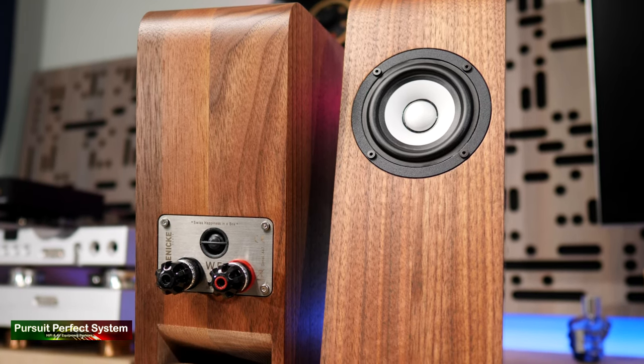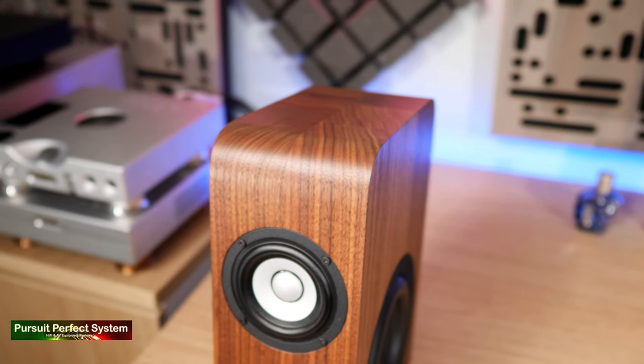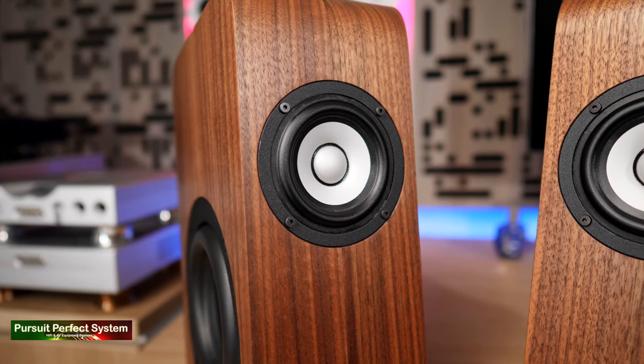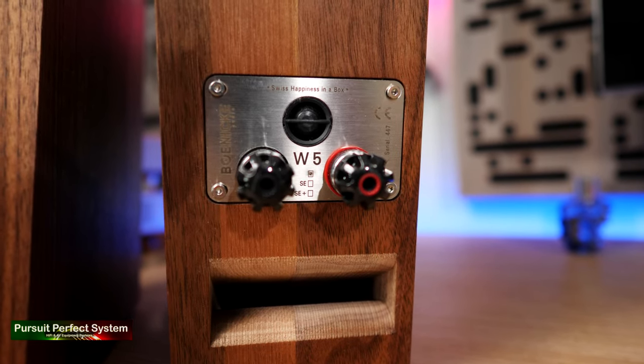One thing you are very aware of is the excellent treble detail retrieval from the forward firing and rear firing driver combination. Now, I was fully expecting the W5s to have quite a rolled off treble given the fact they are using really a small speaker to do their treble as opposed to a dedicated tweeter. But when I measured the speaker's frequency response in my room, I was very surprised to see a very extended and very linear treble as opposed to a rolled off treble, and you can definitely hear that aspect to the speaker's performance. I don't know how much of that is down to the forward firing wide bander driver or the rear firing ambient tweeter, but you are very aware of very, very detailed and lively, energetic treble from these speakers.